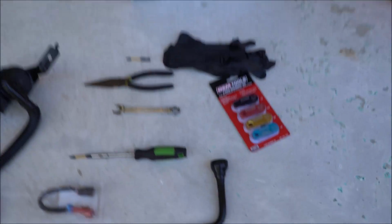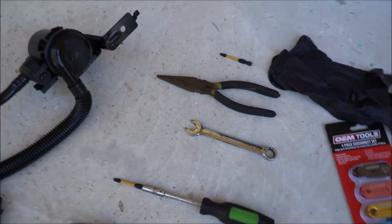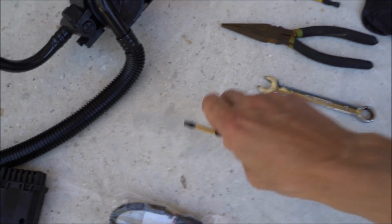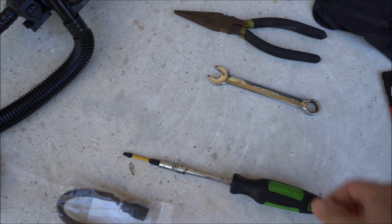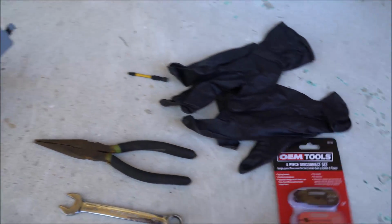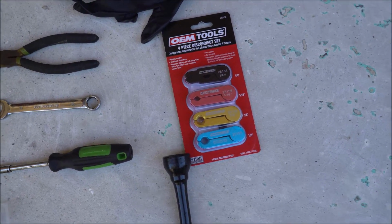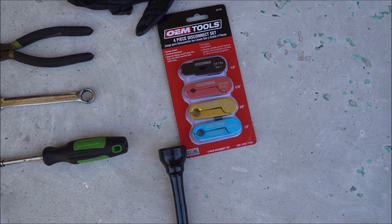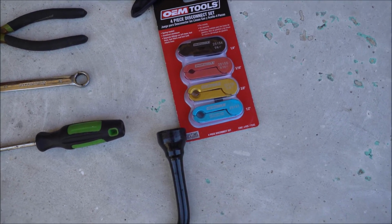Some of the tools you need to lower your tire, so you need your tire extension kit there. T20 and T30. Star heads or Torx, 13mm wrench, pliers. I got some gloves here, and you don't need these, but I like them because they're easier to disconnect the fuel lines with, so you don't have to get in there with a flathead screwdriver. I picked that up from AutoZone. I'll also put that in the link below.